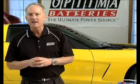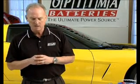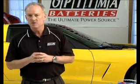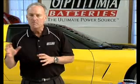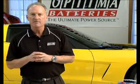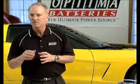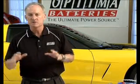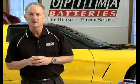Then when the season's ready to go and you're ready to use your car or boat again, you've got to fully charge the battery, okay? It probably didn't discharge enough not to start your vehicle, but don't use your alternator to recharge that battery. Use a good battery charger and fully charge the battery before you use it again.